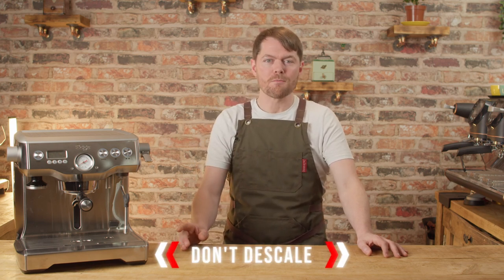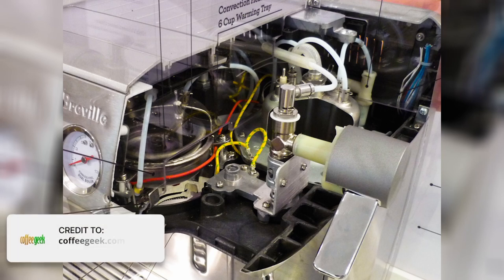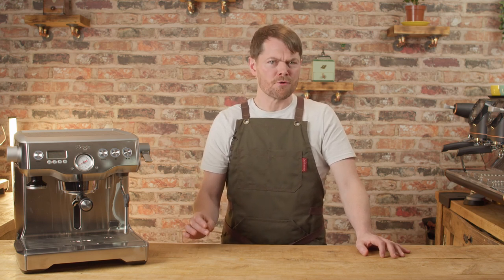How can you make sure you never have this issue? Ensuring this never happens to you is very simple — just two words: don't descale. Although this looks like a home coffee machine, they're designed internally based on high-end commercial espresso machines, which is what makes them so great and why they produce such amazing results. The only issue with descaling a machine like this is that they can't be descaled like domestic machines where you simply flush water intermittently through the steam wand and the group. They've put the drains in to try and make descaling possible without taking the machine apart, but issues can happen when descaling this way — mainly airlocks — now that they appear to have stopped the potential issue with the thermal fuse blowing.